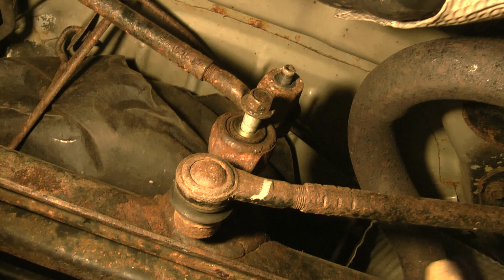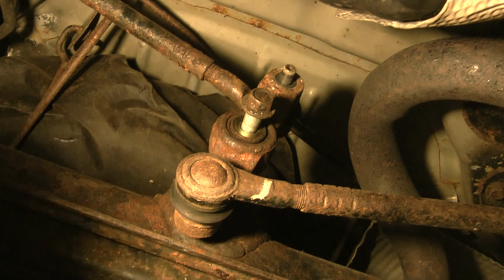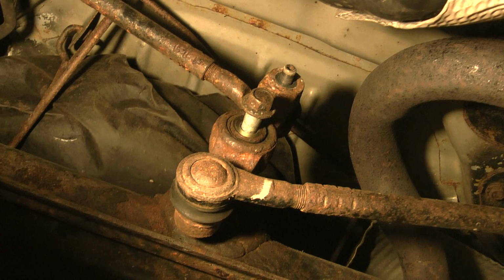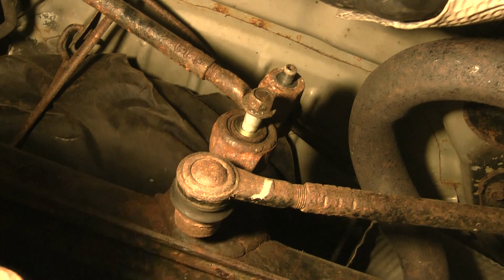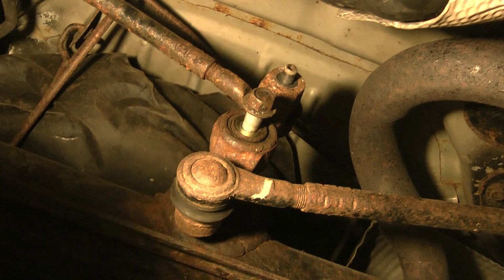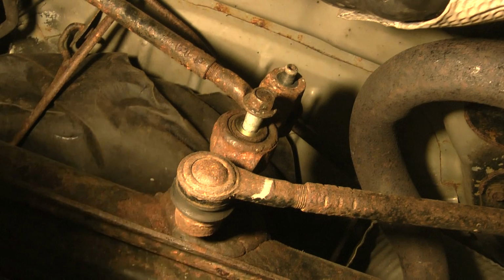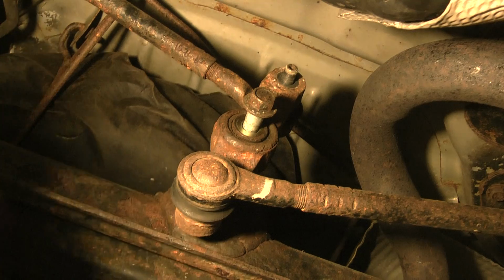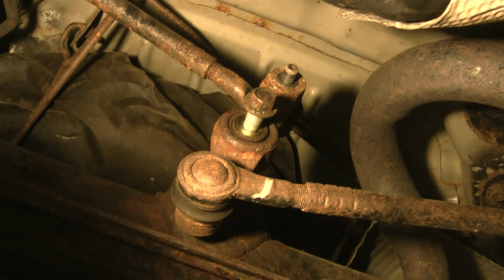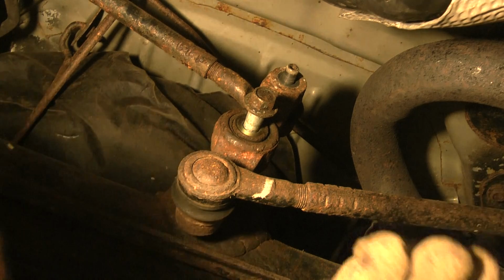and it will hold the center frame centered to the axle, so when you turn around a corner, the body of your car does not swerve back and forth. The only thing holding this centered to the frame is the springs, and there's nothing else holding this car to the center. So this is what the Watts link is. It keeps everything centered, and it's not too hard.